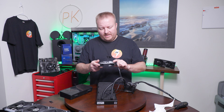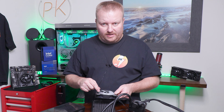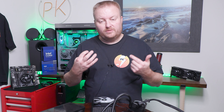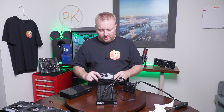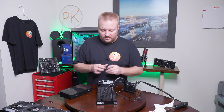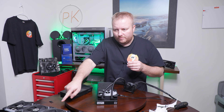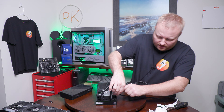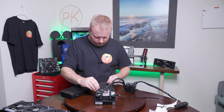There are a couple of ways to do this: we can have the fans drawing air through the radiator, or pushing air through it. The way I'm going to do it is to push air through the fins rather than pull. I can't do a push-pull and I want the fans on the inside of the case, so that's the only way I can do it — it'll draw air in from inside the case and push it to the outside. I've got some extra long screws from a kit; the Lian Li fan screws are too long so I'll use the kit screws instead. There's one fan down — remember you want them all going the same direction.